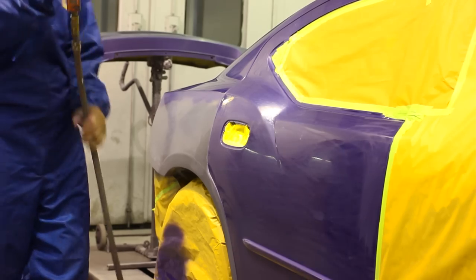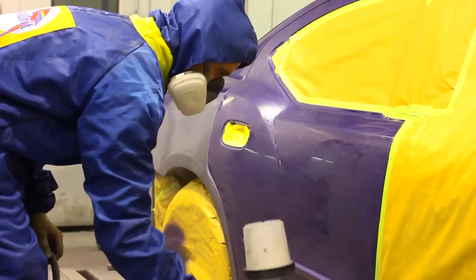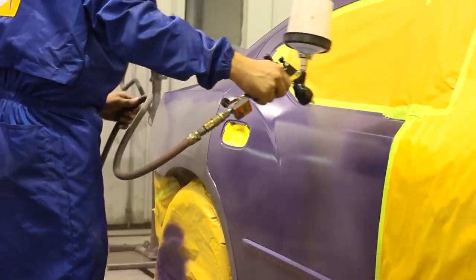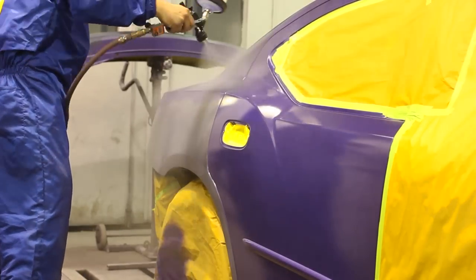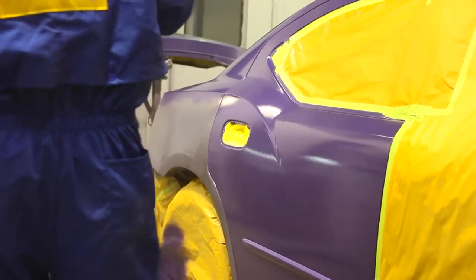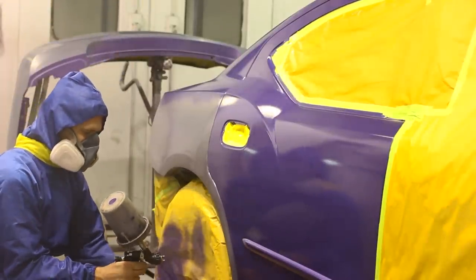I was a little concerned about the door — the prep work wasn't as nice as I'd have liked. You can see the finger marks in it, which means they were pressing with their fingers through the sandpaper. I like to treat blend panels with a DA, use 1000-grit paper, go over with a sanding paste and a gray pad. That gives the best uniform finish. This will also fill in minor scratches and block metallics from getting caught in the grooves, which matters more on silvers and golds.